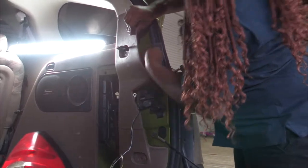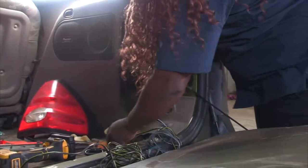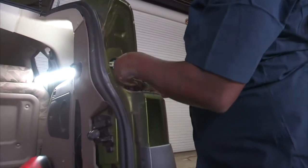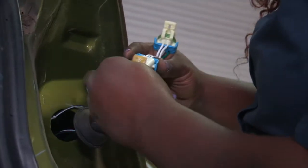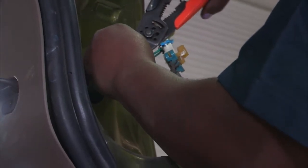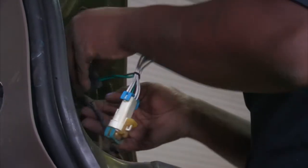I'll route this here first. Now once I got it up, I'm going to pull this through all the way, and it's open and out. I'll connect this into the passenger side — that clicks in. And I'll take my clips to open this fascia here, and I will put this back in. Now the wire is connected.